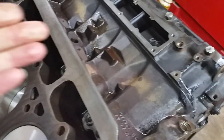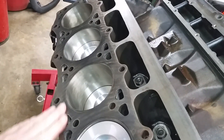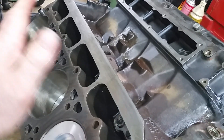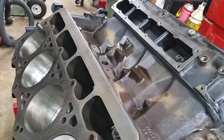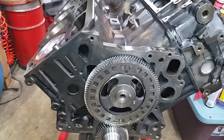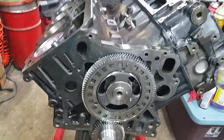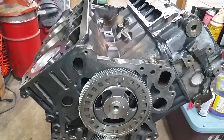Things to remember: oil-free on this surface. Make sure you wipe it down with brake cleaner or acetone, then follow it with denatured alcohol and then it's completely oil-free. Do the same thing to the cylinder head, then set your gasket on - there's only one way they go. After the head's on we've still got valve train to put in, the front cover. I might make a video on what I'm doing with the oil pan - I'm going to solve the dipstick thing once and for all with a little bit of machining: cut one down on a lathe, drill it, counterbore it for the dipstick, weld it in, and it's done.